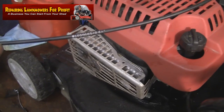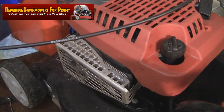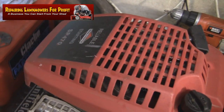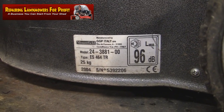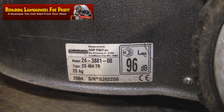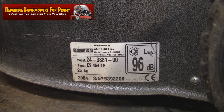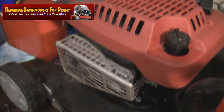Now that the cable is removed from the housing, you'll want to order a new part. Luckily this cable has the part number on it — it's 81000666. If the number has worn off, cables can vary even from year to year on the same model, the Mountfield SP470, as they may have different connectors. If you're struggling, check the ticket on the side of the mower, write down the details, and especially note the year. I've been ordering parts recently from a company called Lawnmower Spares UK Limited — that's just a company I've been using, no affiliate arrangement.